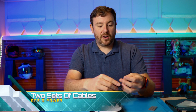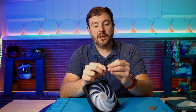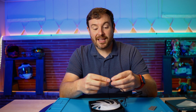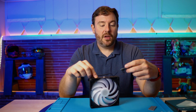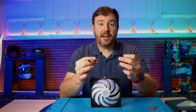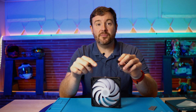The last little thing I want to talk about are these splitters right here. You'll know you have two cables — one cable that has two notches inside of it, and another cable that has essentially three pins, and they kind of look like they could plug together. What this is is a daisy chain. You can plug multiple fans into the same header as long as you don't exceed the amperage of the header itself. That is perfectly safe to do. When I pull the case out, that's exactly what I'm going to show that Phanteks has done on the front of Project 7.